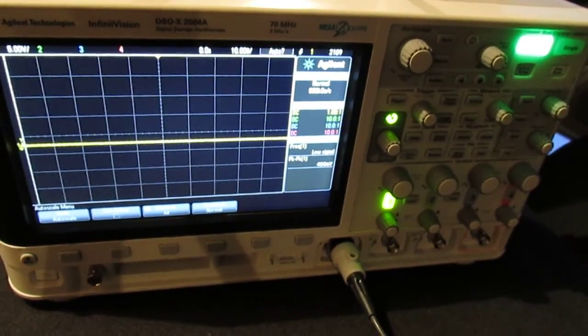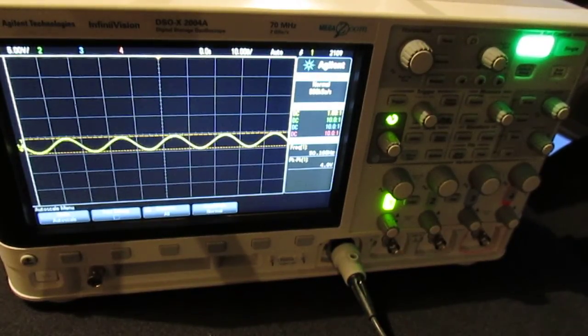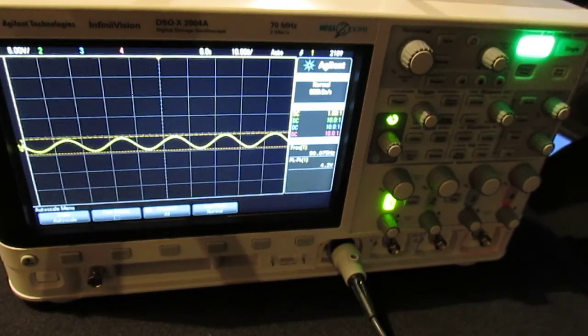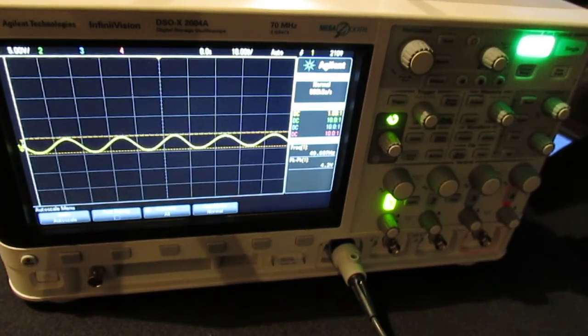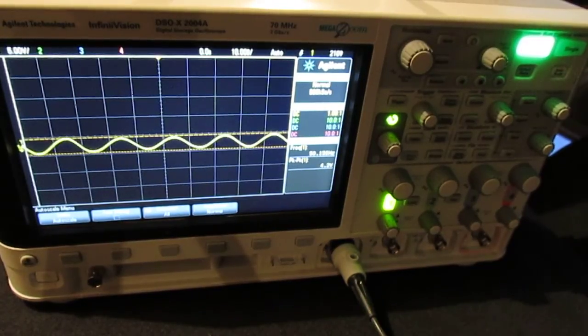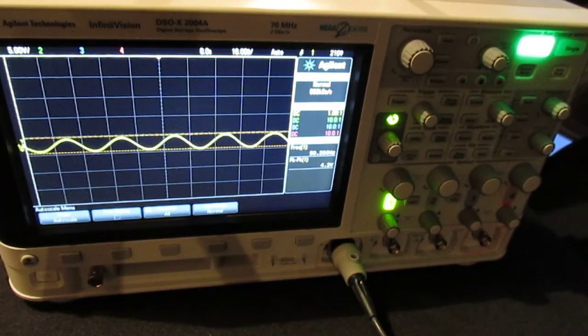So we're on track 1, which should be, I believe, a 50 hertz signal. So you can see right there, as it sits right now, it's showing a peak to peak voltage of about 4 volts. Now, the Kicker amp I'm using doesn't really like anything above 8 volts. So I'm going to set it to under that, 7 to 8. Even though if I maximize this LC2, it'll push out more voltage, but the amp doesn't like it. It'll go into somewhat of a protect setup.